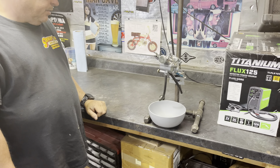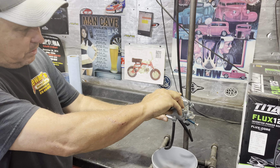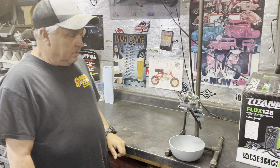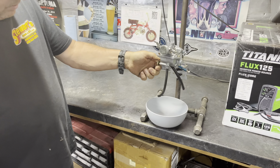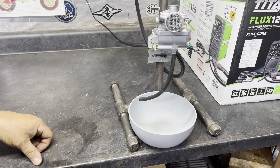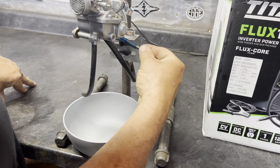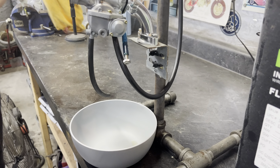So far, I don't see any leaks anywhere. We're going to put this in reserve — I don't remember which one this is — and let it sit for a second and see if any gas comes out of the carburetor after we open the petcock. Just a couple seconds — no gas. Looks like we've got a leak. Oh, it's coming out of this hose right here — that's fine. Sometimes my hoses leak a little bit; this is an old hose. I don't want it leaking out the carburetor anywhere.